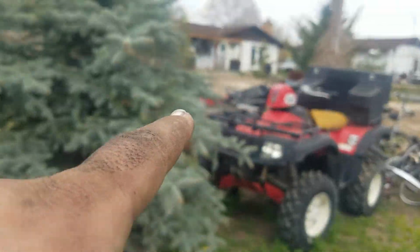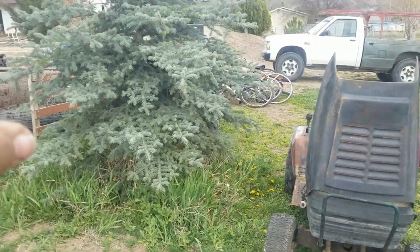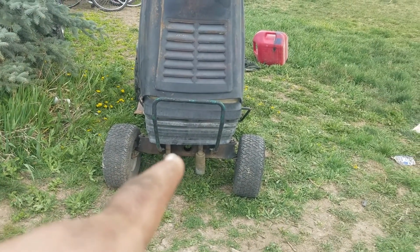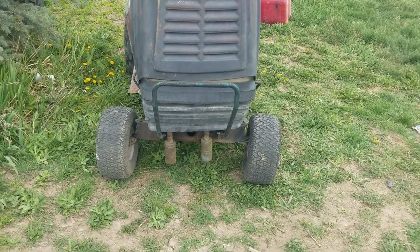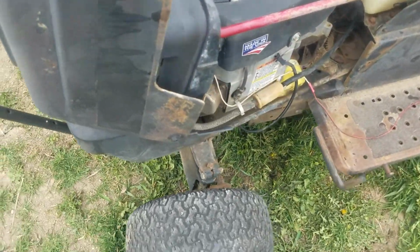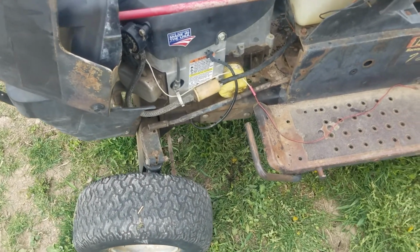You guys seen what I did to that mower, that one. How I switched it to an LT 1000 front end, and it does not flex, which that's my race mower over there, mud mower right here. And since that was a race mower, it was okay that it didn't flex because taking corners would be better. This one I want to continue flexing, so I'm going to just rebuild this front end how it is, get new bushings for it and stuff, or make some bushings or whatever. It shouldn't be hard. And it's not wallered out like the last one, like my red one is. So it's just the rims and the tires need new bushings, and the hubs need bushings, and that's pretty much it.